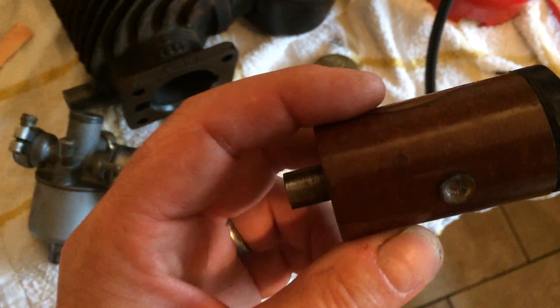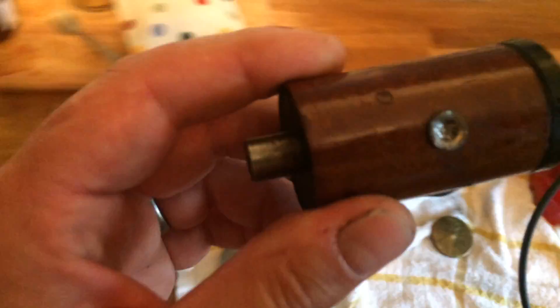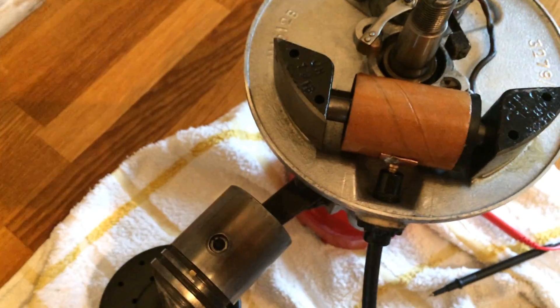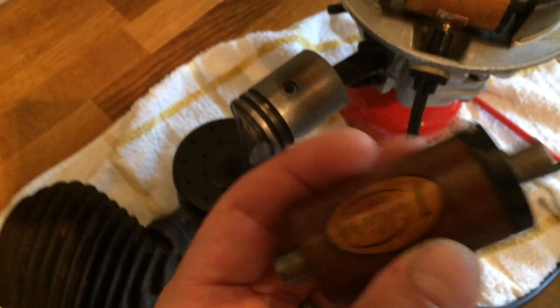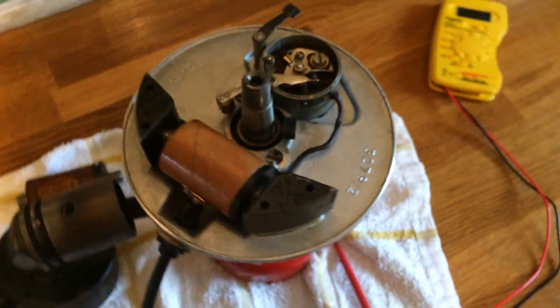If you've got five, then you should be fine. This old one is an open circuit — the copper windings have broken down; it's 60 years old so that's not surprising. I don't know the quality of these Taiwanese ones, but this one cost 23 pounds including postage versus 60 pounds plus VAT for the genuine part, so I think it should be okay for what we're doing.